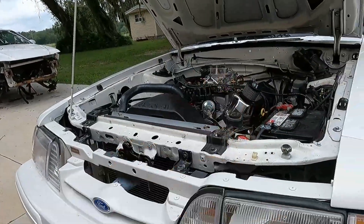I just shut it off. As you can see, making my adjustments actually changed the air-fuel ratio — that's what you want. You want to be in the area where the needles have an effect on the AFR. Sometimes when you adjust the needles you've got to wait about 30 seconds for it to actually start making the change, and sometimes you've got to snap the throttle to get it to settle. If you're not getting adjustment, you've got a problem somewhere else. I'm going to leave it at about 12.5 to 1.